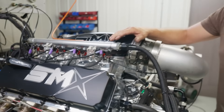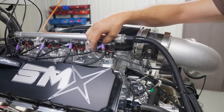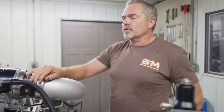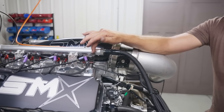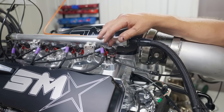They're quite a bit big. For how small an injector they are, that is at 75 pounds. I think this is 280 pounds per, something like that. Really pretty cool and will be a really nice driver on regular gasoline for the street cruise portion that he needs to do. He can run on gasoline, he can do a lot of stuff. I'm thinking about these little injectors myself, a little high-impedance injector instead of the great big injector I have for street drive. I might talk to FuelTech about that.